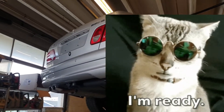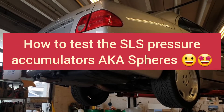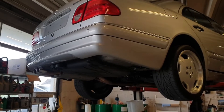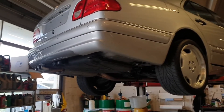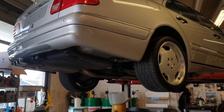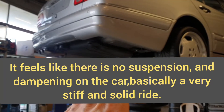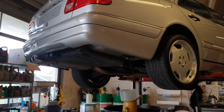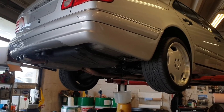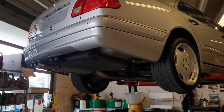Welcome back to my channel. Today I am doing some fault finding on the SLS system on my E50 AMG. This car has ADS suspension, which is an adaptive dampening system. The main system in the back is pretty much a conventional SLS system but it does have some additional valves for the struts. I am dealing with a bumpy ride and I'm crossing my fingers that it is the pressure accumulators for the SLS system causing it.